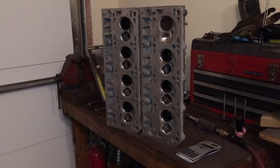So the goal at this point is to do the cylinder heads, including port work, new springs, seals, machined locks, you know, all of the tricks that I like to do when I build an engine. I want to port one of the Dorman 3-piece, what I call long runner truck intakes to put on there. So basically you're going to do a cylinder head, cam, an intake upgrade to this 4.8. Also, of course, you guys know, doing the LS2 timing chain upgrade.